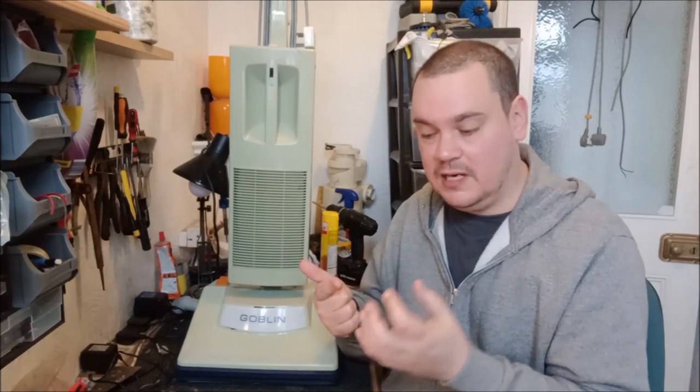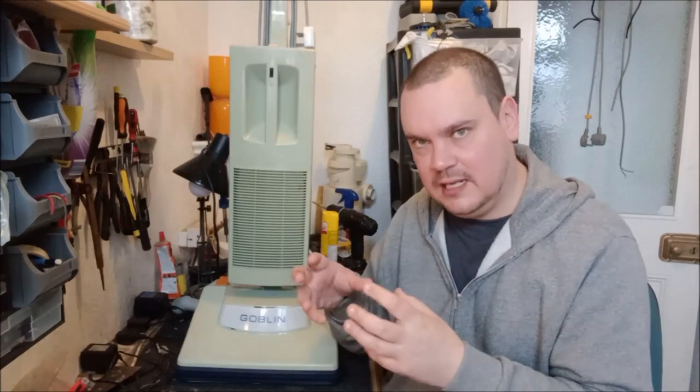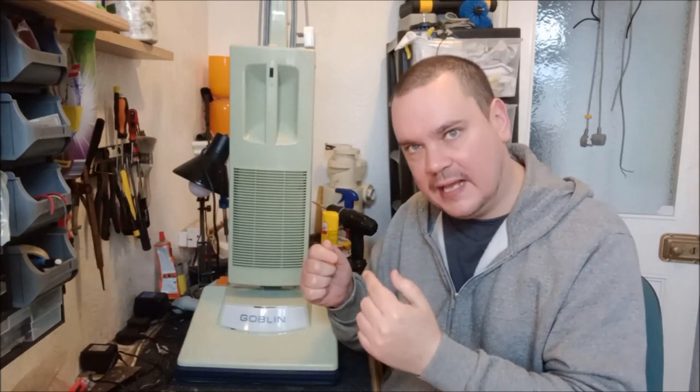It's not the fact that the shaft is worn. That is sitting on the bearing perfectly fine. But the bearing itself is moving within the end frame. When you assemble it again, the bearing moves back and becomes loose in its hole. I was like, oh, for the love of God.